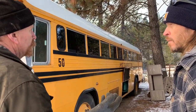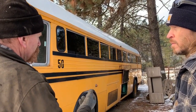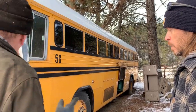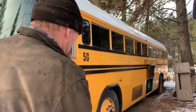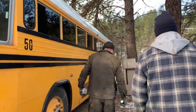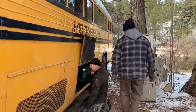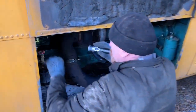I had it, what was it, Monday night or Tuesday night? Monday night. I had it cranking, but I lost the batteries, so I had to charge the batteries. Tuesday morning it still wouldn't start, so I had to prime it, because usually a Detroit will pick up its own prime. I've done that before, where I didn't have a certain switch in the right spot, and then it shut itself off. And then it runs for like 5 minutes. Why did it shut itself off?